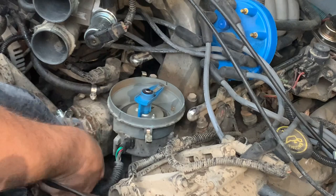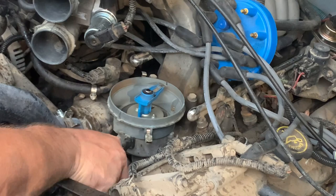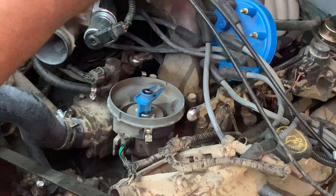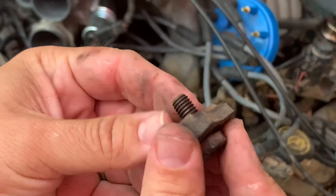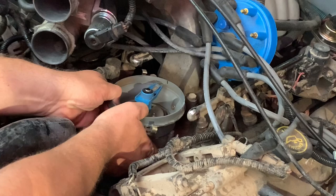It's bolted down tight and the timing is set. I'm going to take the half-inch wrench, go down here at the base of the distributor, and loosen the half-inch headed bolt. You want to go ahead and remove that all the way. This is your hold-down and this is the bolt — it's half-inch and you'll need the wrench for it.